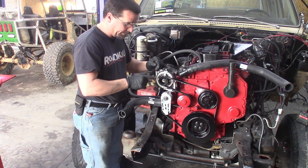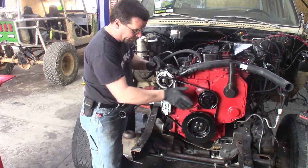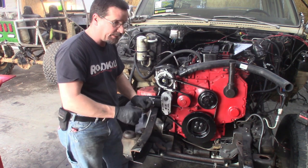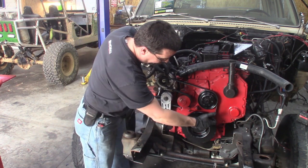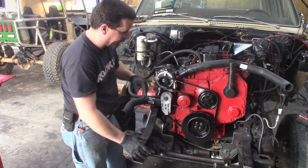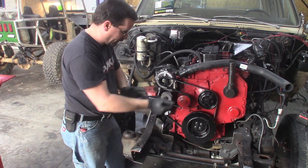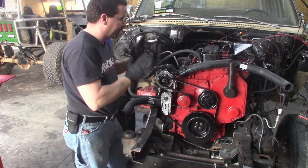One other thing while I'm up here — this is where the crankshaft position sensor goes. One of the reasons I looked all over for a 12-valve balancer is that a 24-valve balancer will bolt on just fine and they're readily available — they re-pop the 24-valves but not the 12-valves. But the 24-valve doesn't have these two notches right here. We can wire the factory crank sensor to work with a tachometer in four-cylinder mode, but the 24-valve balancer doesn't have these notches, so that would not work. We'll show you that in another video because wiring is going to be a whole other deal.